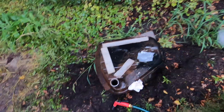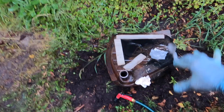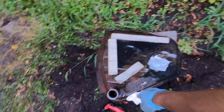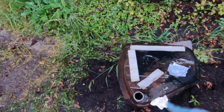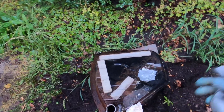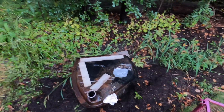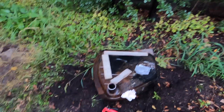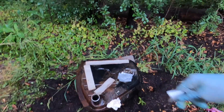I did a couple of flushes with baking soda and then poured about half a cup in and filled the tank all the way up the filler neck after taping off the sending unit hole, so the entire tank from bottom to top is now neutralizing with baking soda. I'll let that sit for about 20 minutes, then do one last flush — keep flushing until I'm positive there's nothing in there — and then blow it out with the air compressor until it's dry.